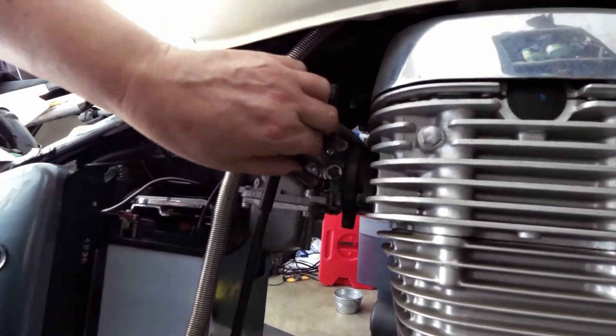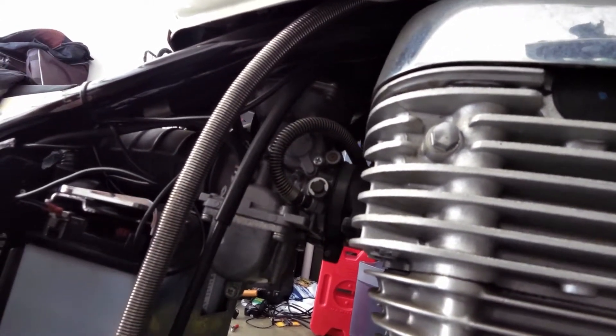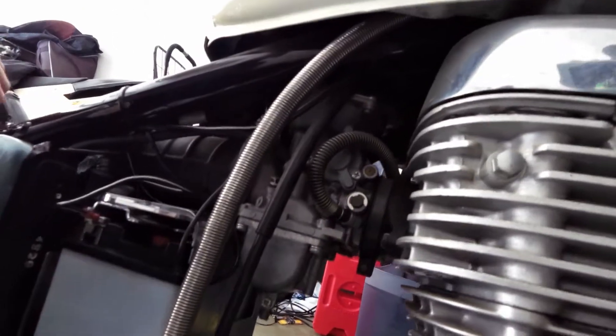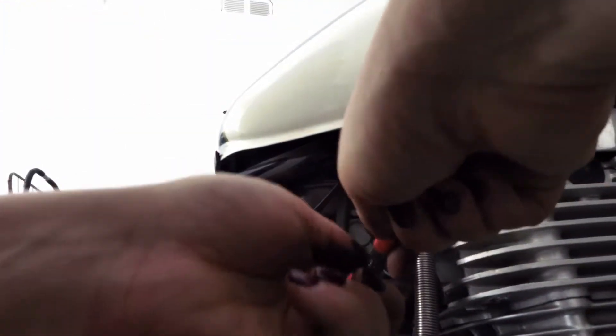It's that one right there with the coil wrapped around it, and it has a butterfly clip on it that's keeping it connected. With the butterfly clip, you don't squeeze it together — you actually separate it to loosen the clip. I used a pair of needle nose pliers to stick in there and spread it apart to loosen the clip and then slide it up.